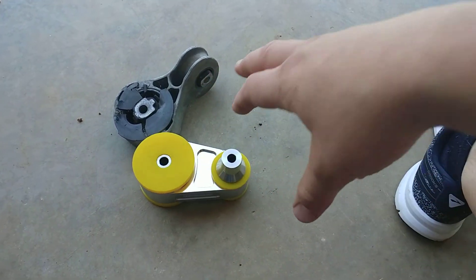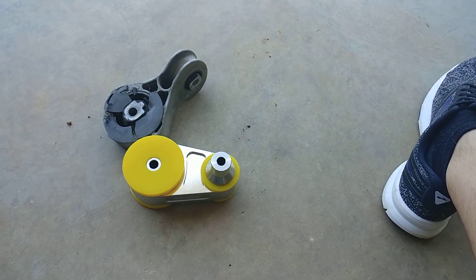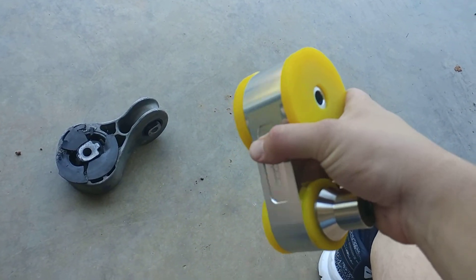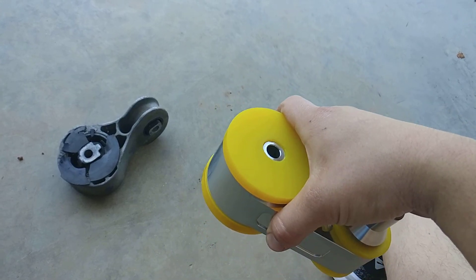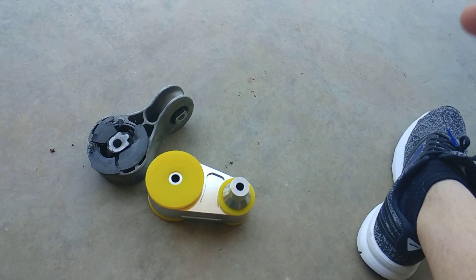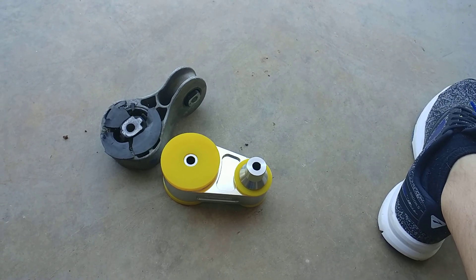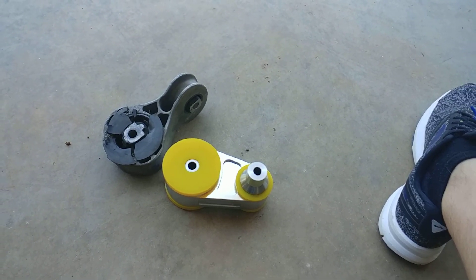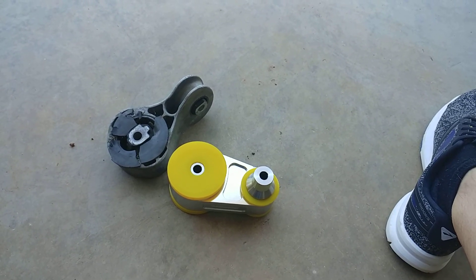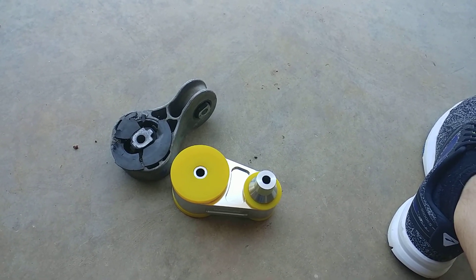Today I want to make a video about rear motor mounts and why they are such a popular upgrade among cars. Why do manufacturers not put a better rear motor mount in the car to begin with? Simple: vibrations. You have to have pros and cons. Most people who buy a new vehicle — if you start it up and the dash is vibrating, the headlights are vibrating, the side view mirrors are vibrating — they're probably not going to want to purchase it. So you have to have a balance between firmness and softness.